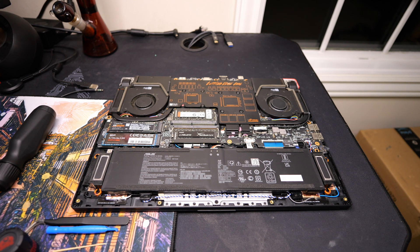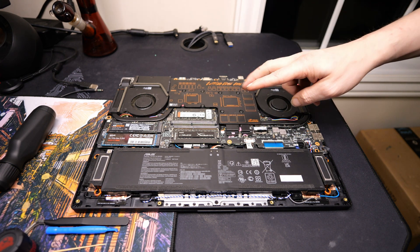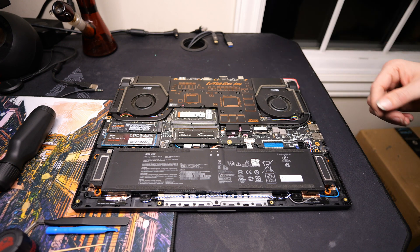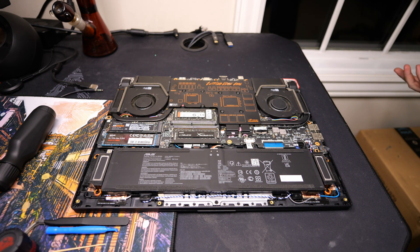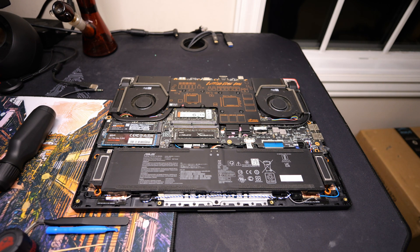I already did all the crazy parts — taking it apart and putting the new screws in. This time I decided to combine two washers with the spring instead of three. Figured maybe three wasn't actually making as much contact as I thought. The spring might do better because it fills in that gap and has tension. We also put all the thermal compound on, took all of the thermal pads off, and replaced them with compound. It's non-conductive — it ain't gonna hurt nothing.